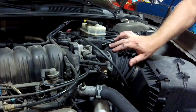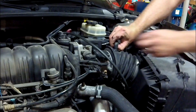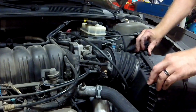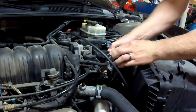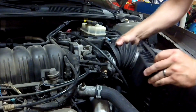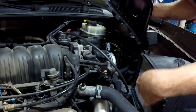In order to get this intake inlet tube off, what we have to do is disconnect the intake air temp sensor and unclip the box here. This should pop out, and this just pulls off. You've got to pull kind of hard and work it around. Then lift up on the box, and these tabs should slide out of the slots there on the air filter.